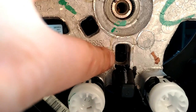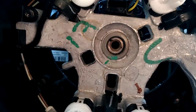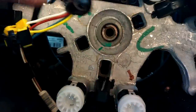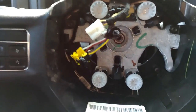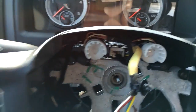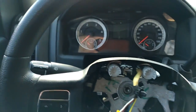When you put the steering wheel, make sure this wiring comes through this area right here. There's a clock spring aligner pin on the bottom, and the steering wheel shaft has two passages on the top and the bottom — you cannot really install it in the wrong direction, it only fits one way on the shaft. After it's all assembled, plug it in — that's my clock spring hooked up. Pretty much all the switches are now supposed to work if it's fixed.